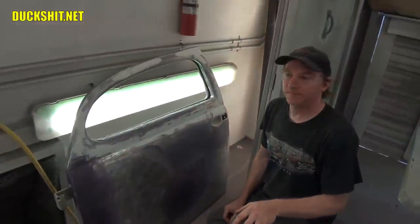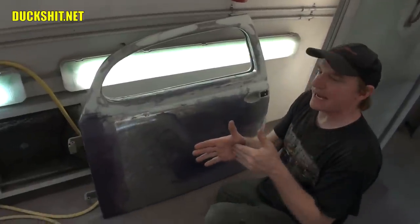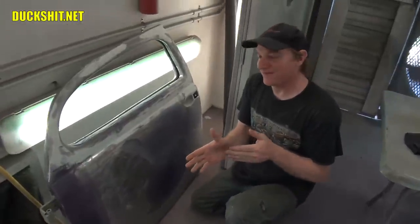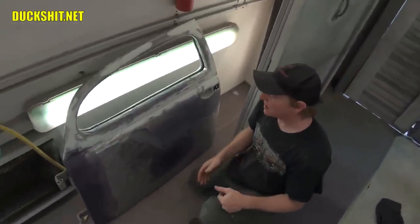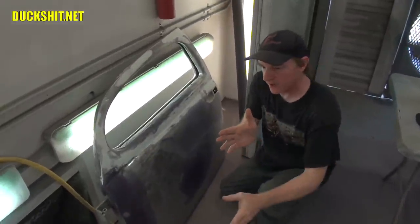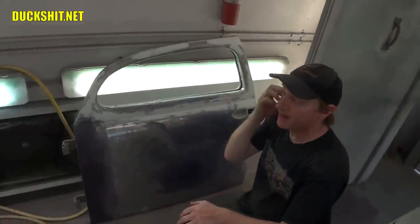Now tell us what happens to the metal if it did stretch, if you didn't do it the way you're going to do it. You really got to find a way to shrink it back, and it's not an easy technique to do. A lot of it's lost art. I've done it with some success, but I mostly try to get it to where there's a point where you're good. If you keep going, you don't want it to get oil canny. If it does, you're not going to get it back, especially some of the old 50s sheet metal we've done in the past. It doesn't play very nice.